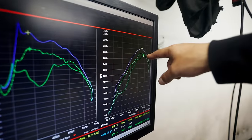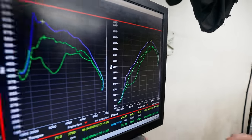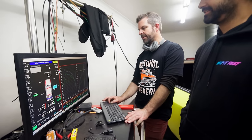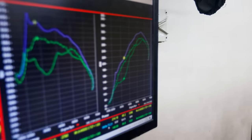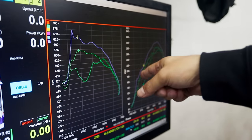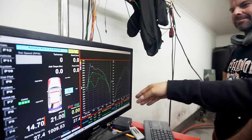So just for your comparison: this line is no tune but with our exhaust — there's that hectic dip. This one is tuned but no exhaust. And then this is our final tuned result with exhaust. Those mid-range gains are exactly what I was feeling — the factory tune just let the car down when driving it. Trent was saying this is ideal for a drift car: mad response, comes on hard at 2,000 RPM, then a bit of a drop-off, but that's alright.